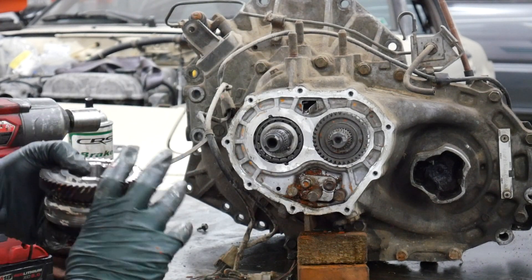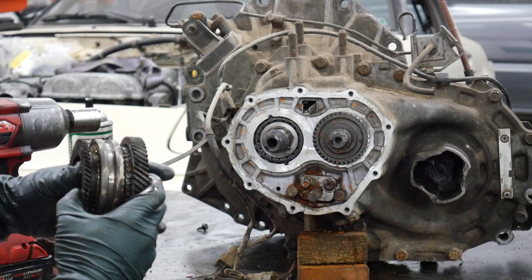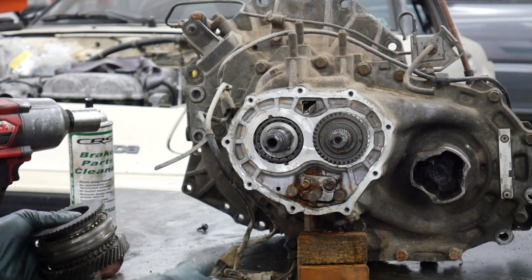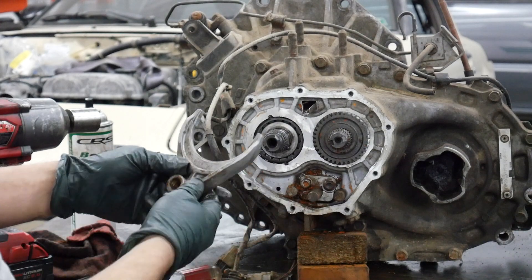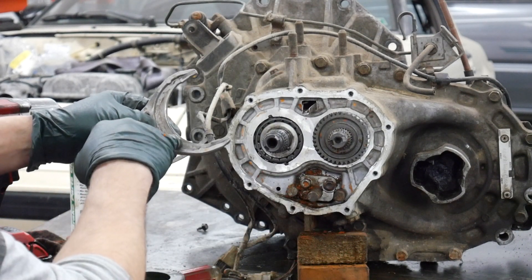This is pretty dirty — your gears probably won't look like this. Whether they're damaged or not, you really can't tell by a simple visual inspection; you do have to pull this apart. Typically I don't see any damage on the slider — most of the damage happens on this fork. This one has some wear — it's not too bad, but I've seen much better.